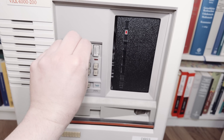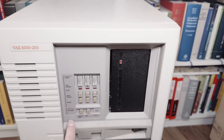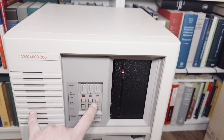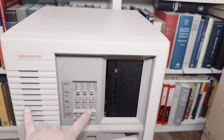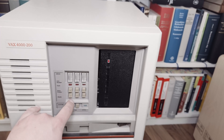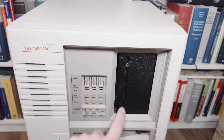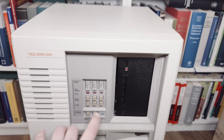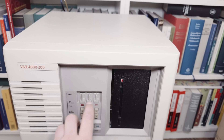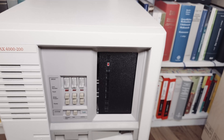Because this is the same panel, you can configure three hard drives, but the DSSI connection goes only to the left part. There's only enough space for one full-height 5.25-inch hard drive or two half-height 5.25-inch hard drives. This is the same board as in the bigger chassis, and the bigger chassis has space for three hard drives — that's the reason you can configure three, but there's not enough space in this smaller enclosure.